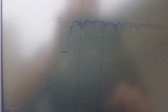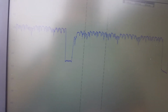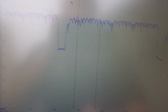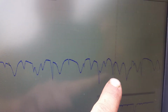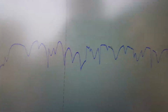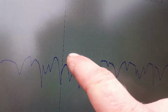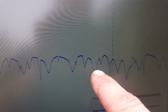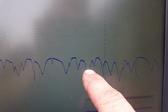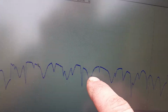And so if I zoom in on that, I took this waveform with it running. So if I zoom in on that, pressing this box and go right here, it's a couple things. From this line to this line is one revolution, and each one of these should be a nice clean high spot bump, like 1, 2, 3, 4, 5, 6, 7, and then 8. Well, this should be a nice arc. It's got a kind of a break up right there, small one there.